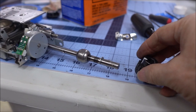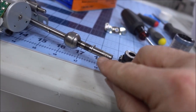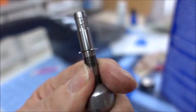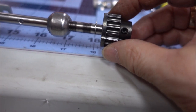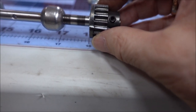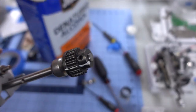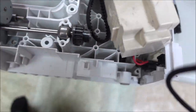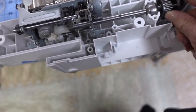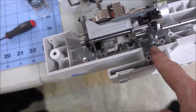We're going to put the gear back on. We lost the keying mark on the end, but there are two set screws that are offset and I can see marks in the shaft on both sides, so I'm going to slide it over and align as best I can using those set screw marks. We've got the gear back in place, the c-clip back in place, the bearing block is all in place. I'm going to slip this back into the housing. The shaft is now turning freely.